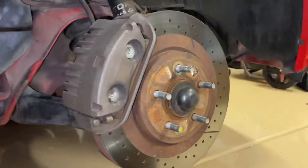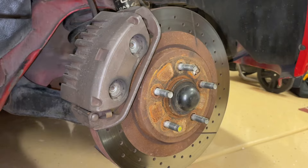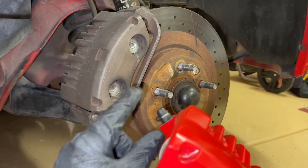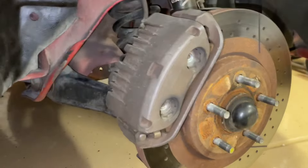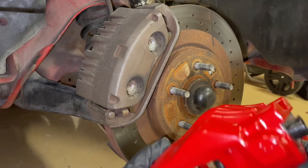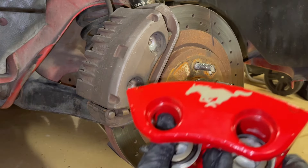Something to note is that they are side-specific. So when we bring in the caliper here, one thing you will notice is that the one I have is for the driver's side. You can tell because the running horse would be going backwards if it were here for the passenger's side. What you see is the bleed screw at the top, and that has to be at the top for it to bleed properly. My brother and I found a Bullitt years ago, and it had the running horse going the wrong way on the driver's side. I wish we could have seen where the bleed screw was — I'm curious about that still to this day. Bullitt number 110, if you ever have that one by chance.